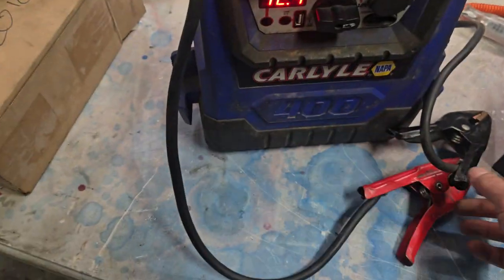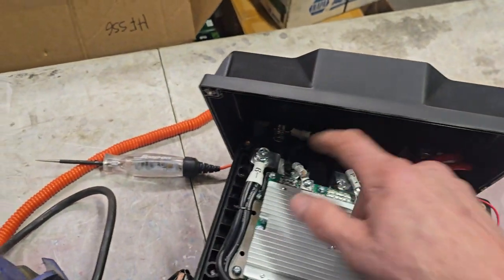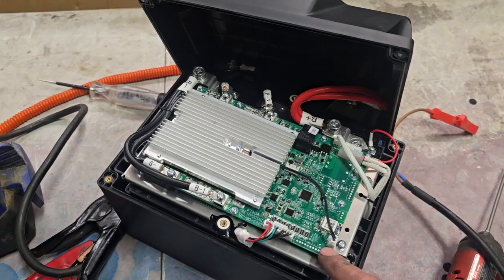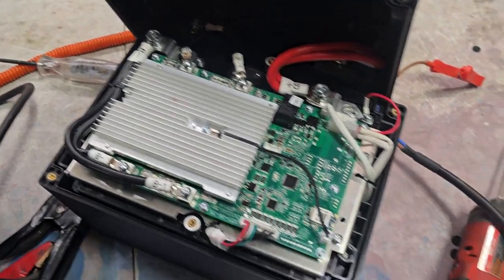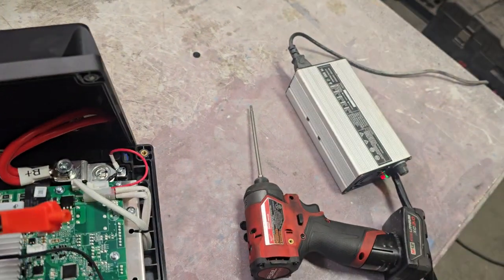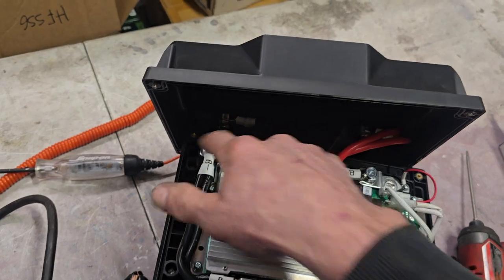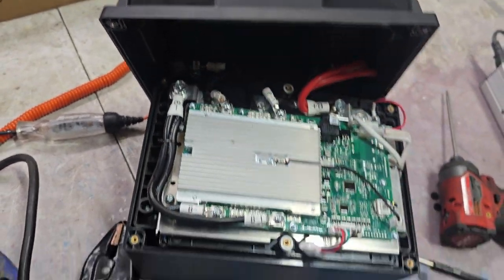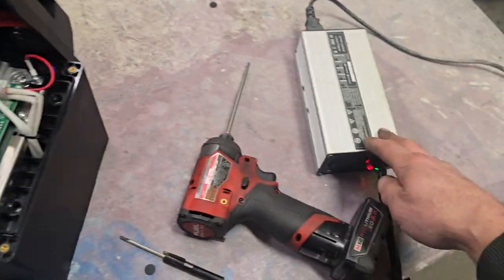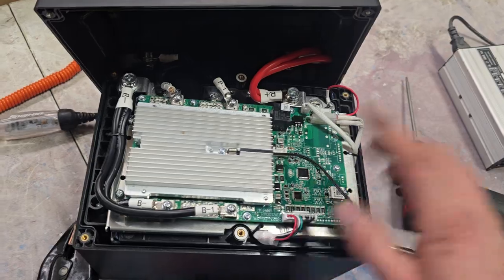This battery needs 12 volts to wake up, and your charger will need a couple volts to begin charging. What I did was put my booster pack on and checked the voltage — I was seeing around 10 volts. I kept going until my charger started to charge when plugged into the top terminals. Once I had enough voltage, my charger came on, so I charged it over 12 volts and then stopped.